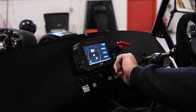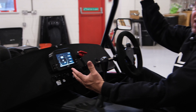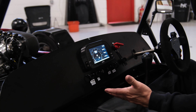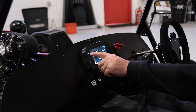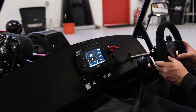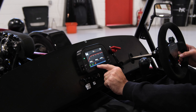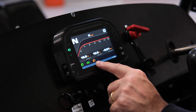If you want a tutorial on how these work and what options are available - we can change the screens, configure different views with various gauges and instruments for track day use, whatever you want. The most important thing for IVA: you must have a default screen that always shows miles per hour - that's most important, it must default back to MPH. So when we put the indicators on, it comes up on the dash. This is all wireless. We can put our lights on here - side and dip, then main beam switches over, all comes up on the dashboard, and fog light comes up on the IVA screen.